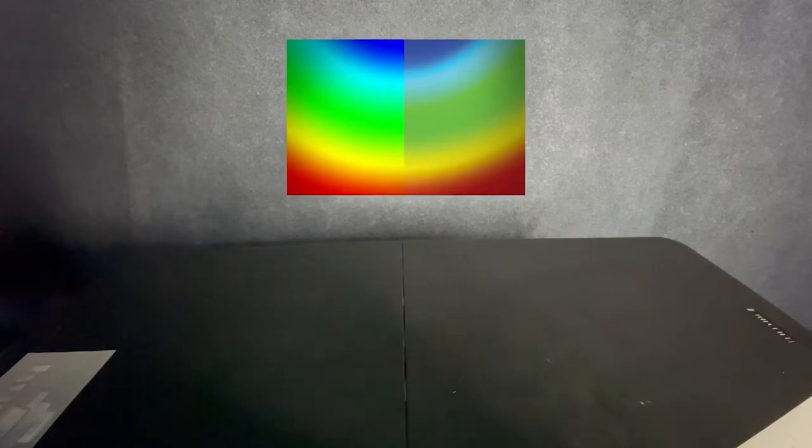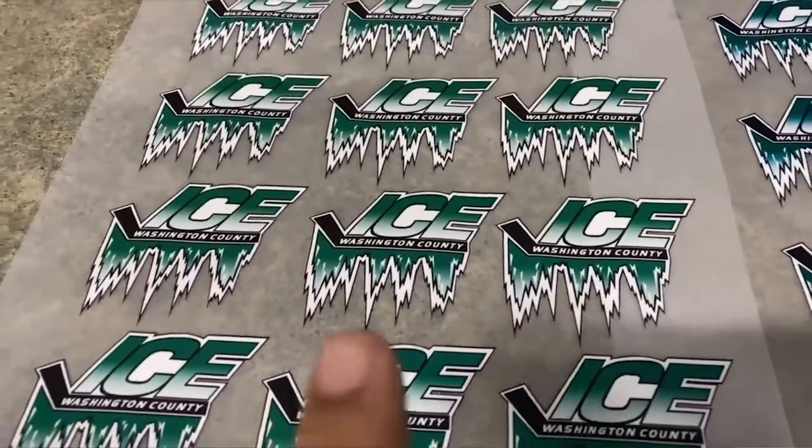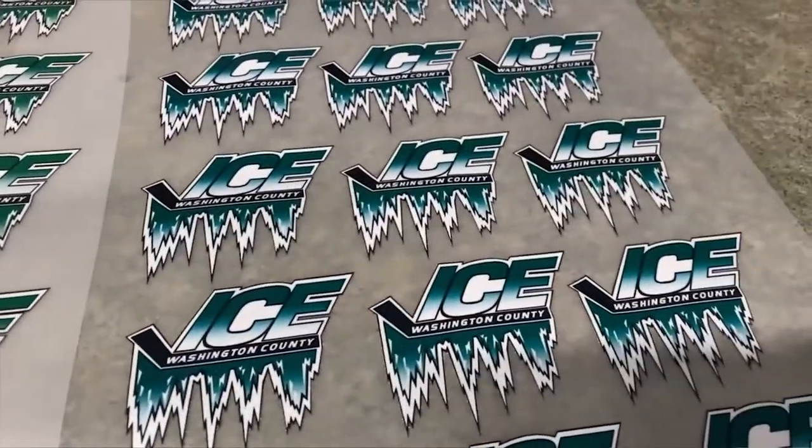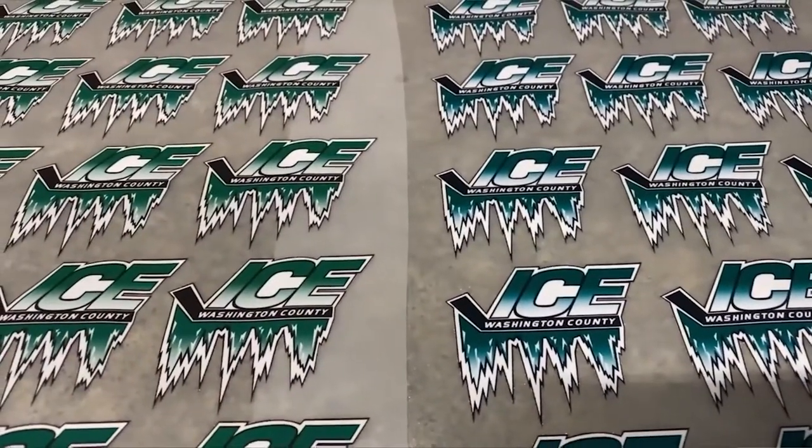If the humidity is too low, the print head may dry out and onboard cleanings will become less effective when problems arise. You'll see problems like color inaccuracies, banding, and faded or dull looking prints. Here in this example you can see how fixing the overall humidity in the room has fixed the colors on this print and transformed them from being bluish to the correct green look.